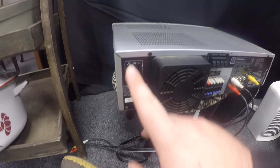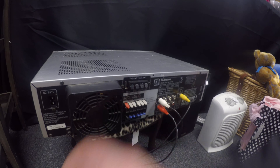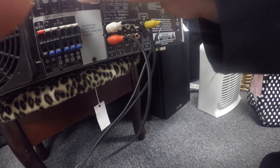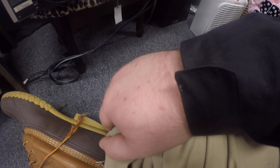Right here you have your AC in — do not plug any TV's power into that, that's not recommended. This right here is the fan. This is an FM antenna, AM antenna. Right here are your front left and front right speakers, your surround left and surround right speakers. These have clips so you can clip them on and wire them up. Right there is your center channel speaker and this right there is the subwoofer.